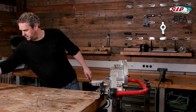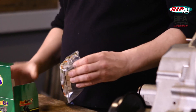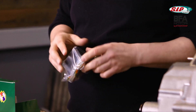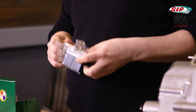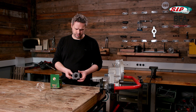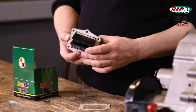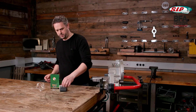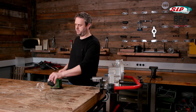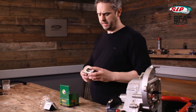You may use other reed valve assemblies, though — like this one here by Italkit. It has one advantage: it's great value for money and it is very nice quality. The frame and the stuffer are cast aluminium and the eight reeds themselves are carbon fibre. You don't have to use this, but you can, with minor modifications. In my case, there is a simple reason for my using it — I already had one, one I have modified already.